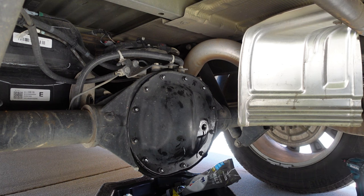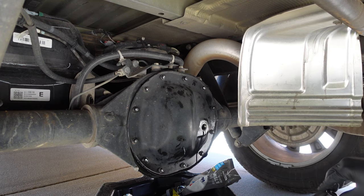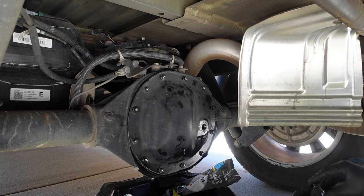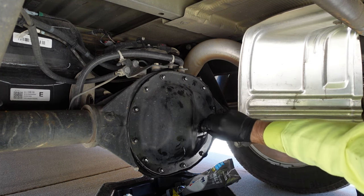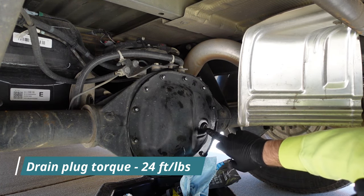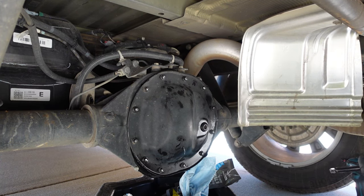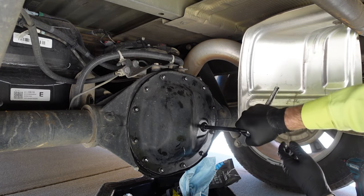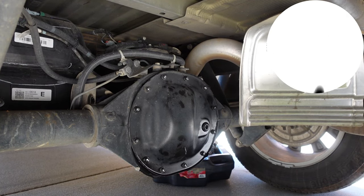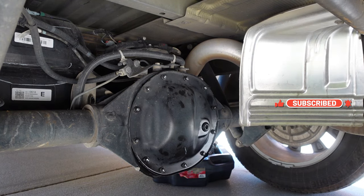I filled it up — it took a full three quarts, and you can see it's just spilling out of the fill hole a little bit, which is good enough. I'm going to wipe this off and tighten it up with the fill plug. The torque spec for the fill plug is 24 foot-pounds. I don't have a torque wrench that goes to 24, so I'm just going to give it a good ugga dugga and tighten it down by hand. And that's all there is to it to change your differential oil. If you like this video give it a thumbs up, I'd love if you subscribe — stay tuned for new videos, see you next time!